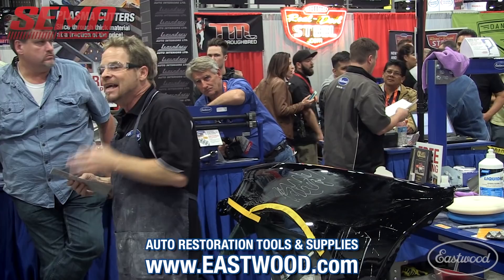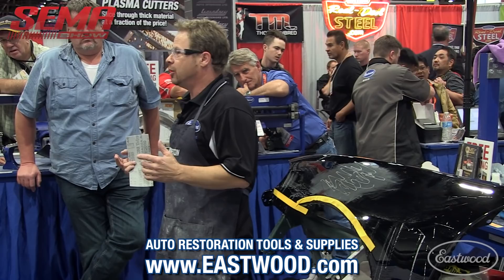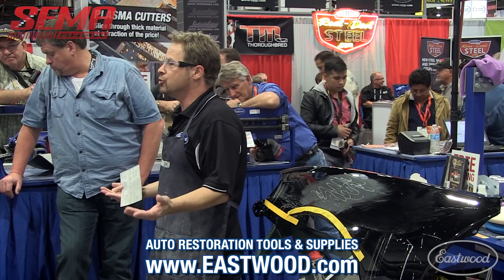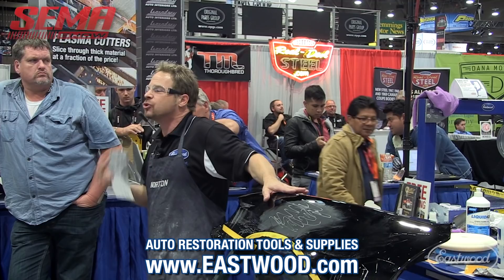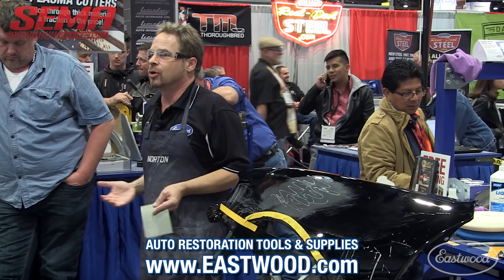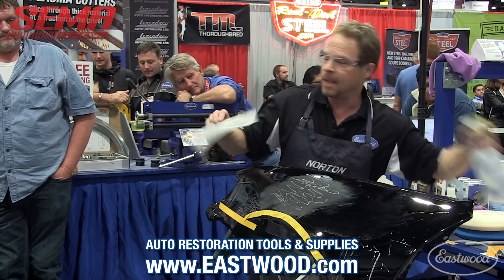The other philosophy — Jesse and Jeff Greening have two Riddler awards under their belt. They do seven, eight, nine coats of urethane coating, but they're spraying it extremely dry so they're getting a lot of saturation and enough film build, while respecting the solvents because their flash times are tripled or quadrupled. They're using dry coats and building it up — not wet coats, but enough material to then do the buffing and avoid that chattery look. There's more than one right way to do this stuff.